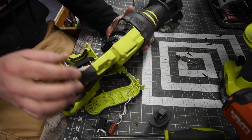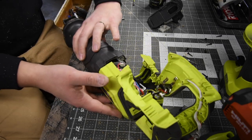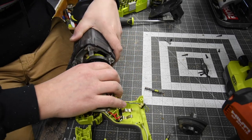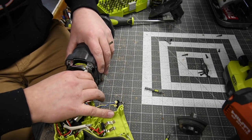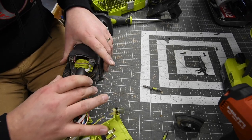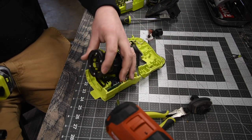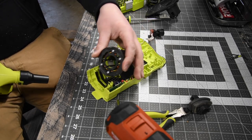There's a lot — oh yeah, there is a lot of sawdust in there. Alright, I got that one last screw to take out. Alright, so I finally got that screw out. This is a magnet. There we go — there is the brushless motor. Since we got this off, we are going to clean the motor, get all the dust out of it, and hopefully that will do the trick.